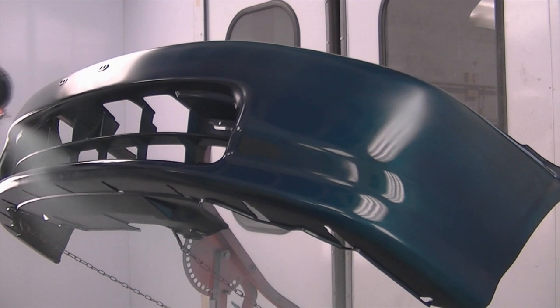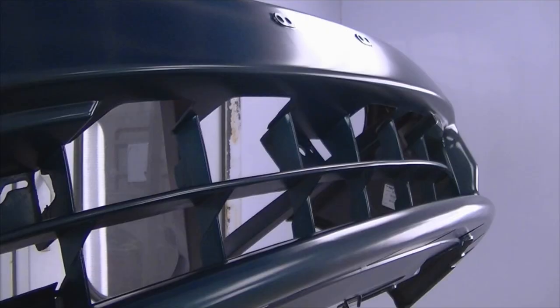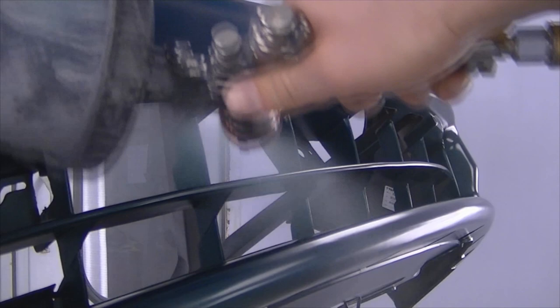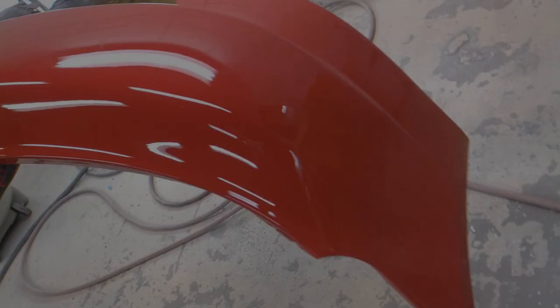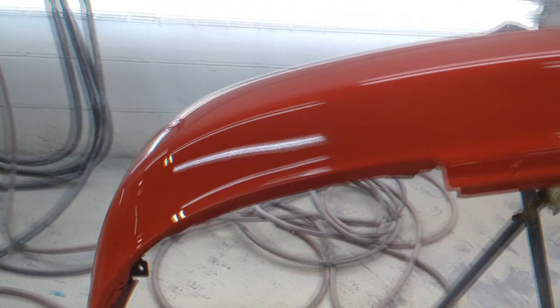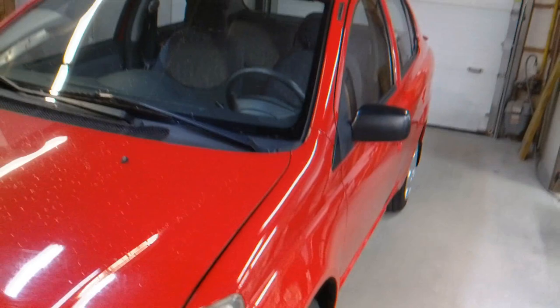When it comes to spraying grills on bumpers, this one's pretty bad — spraying a transparent color is twice as hard. It's difficult to get material on wet and covered well, so you really want to check those little gaps to make sure you get full coverage. Here's a Toyota bumper I sprayed yesterday that I had to respray today because the first color was a little too orange. The second time around we got it to match and everybody's happy. There are also some other Toyota bumpers sitting around — the truck's on the rack and we have a bit more work to do.